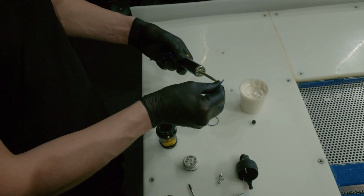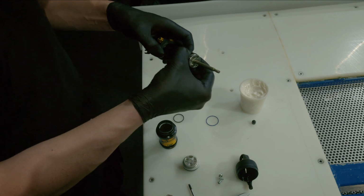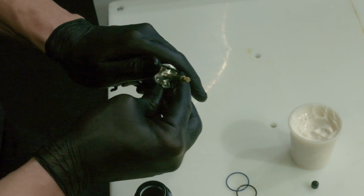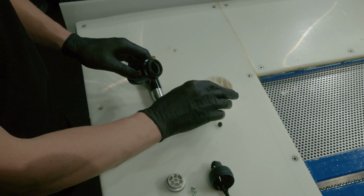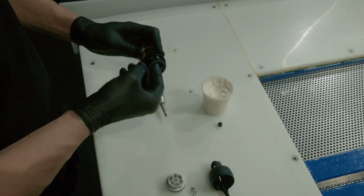Mount a new sag O-ring on the outer cylinder tube. Do not apply assembly grease on the O-ring. Assemble a new O-ring to the cylinder tube. Use the TXC seal tool to slide the air sleeve onto the shock absorber. Be careful not to damage the seals.